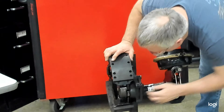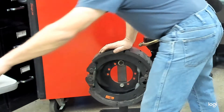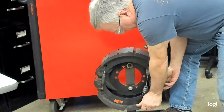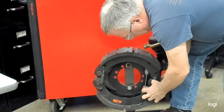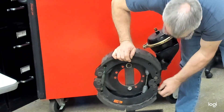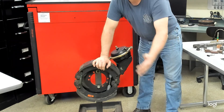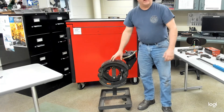Rotating it around — I want to inspect the same thing on the other side. After we install the clip, we'll put the last roller in. With this on the vehicle it won't move around on you, but for this here you can either use your hand or put your foot there, put the clip into place, and rotate that spring clip. Rollers are in place — now these aren't adjusted, they're at the minimum position, but we'll adjust them out from there once we install the drum, the hub, and the rest of the bearings. But that's how to re-line a wheel end S-cam brakes.